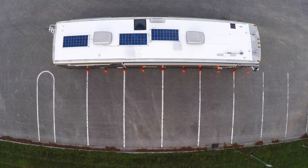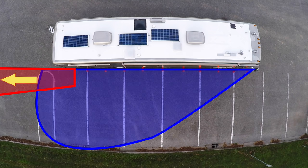Now that they're adjusted correctly, the flat mirror will view a narrow band straight back, starting near the rear bumper and off into the distance as far as the eye can see. This allows you to see vehicles approaching from behind, while the convex mirrors will monitor the area alongside the RV. Again, neither can do the job alone, requiring them to be used together as a team.